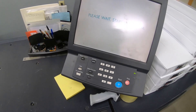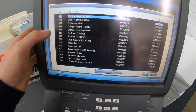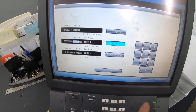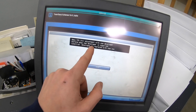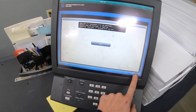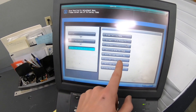We need to go in here and do some adjustments before we reset the counters. Reset the developer counter — Developer Counter Clear. And the toner density sensor: perform this when new developer is supplied, so the developer is replaced. Start — is developer exchanged? Yes. That's all completed. Then we need to do the drum automatic potential, as well as the dot and density, and the auto max density.